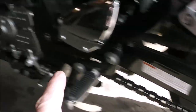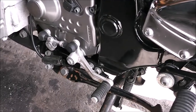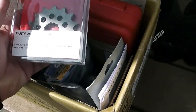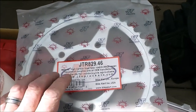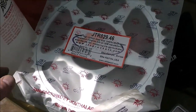We're gonna do the back sprocket and the front sprocket, which involves taking all of this part off. I've got a super light chromoly front sprocket - this is the stock tooth setup. But on the back I changed the gearing: I went with a JT sprocket, a taller gear, so this is going to give me a lower RPM at cruising speed.